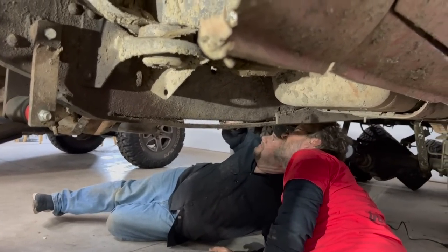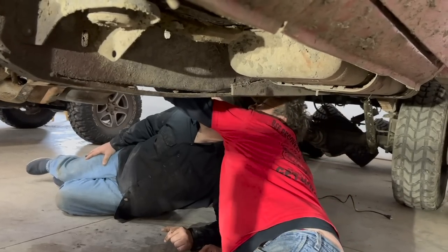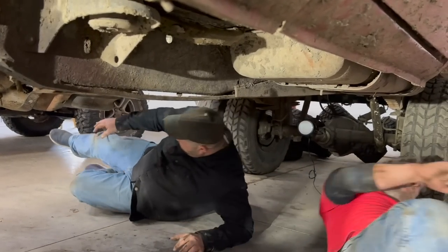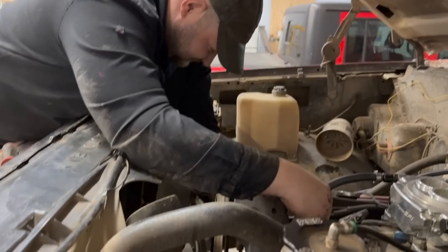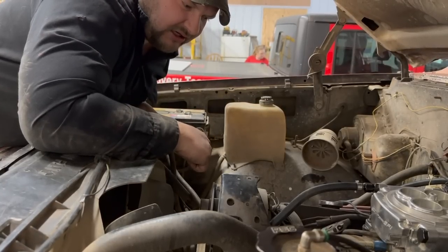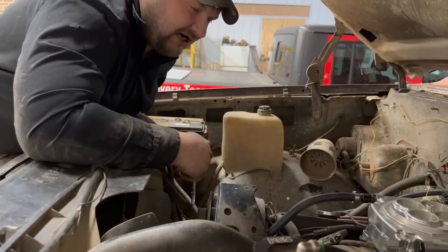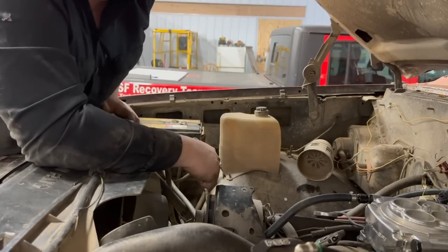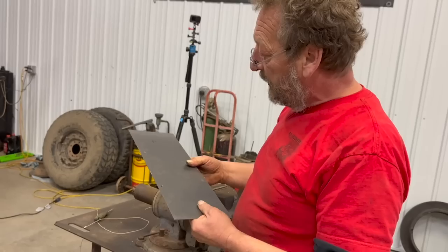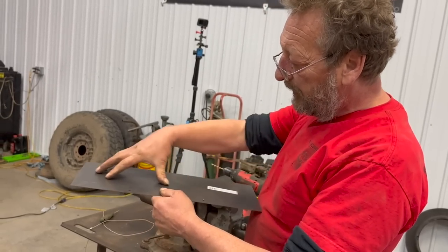You could keep the big stuff from hitting the pump. The switch valve is right under here, so we'll be able to just run it all the way and then use the steel line from the switch valve forward, and bypass the switch valve. I am hooking up the fuel lines to the factory lines. Eric's making a cross member for the fuel pump so we can tie it in between the factory lines and these on this frame rail. This will work perfect — that'll bolt on to the cross member and then we can put all the pump and filters right here.